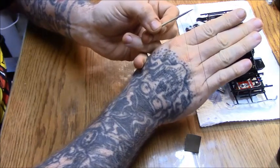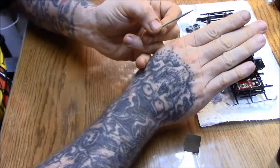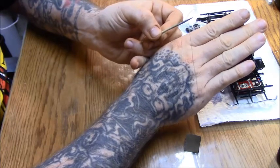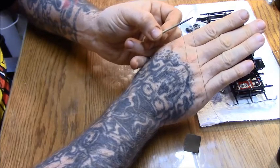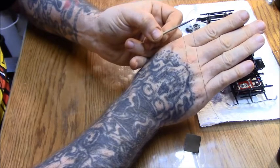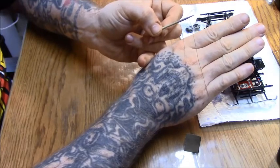As you can see, I went and sprayed it with the self-etching primer and let it dry. I put a couple of thin coats on it — didn't put it all on at one time so I didn't overcoat it too much where it wouldn't adhere. Now it's time to put the paint on it.